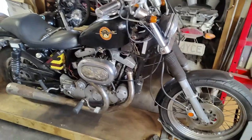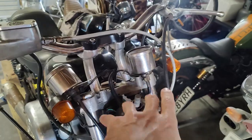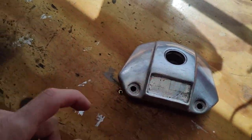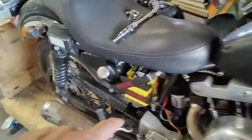Welcome to Wrenching Irons! Today we're finally getting to the iron — the new project. Here's my to-do checklist: we have a flasher relay for the indicators, a head visor with soldered lights. I've welded up the hole inside and I'm going to mark it up and drill the hole to fit these lights — one for indicator, one for high beam. I also have to wire cables going back into the headlight and put in a new brake switch.